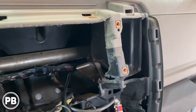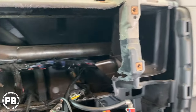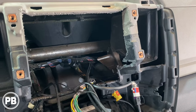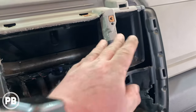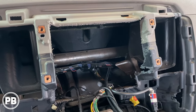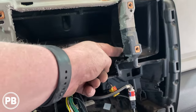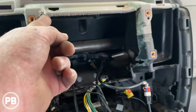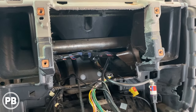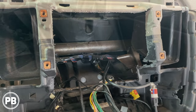This is how the previous installer went ahead and cut the dash. You don't need to cut that much — only cut what you need, but you have to leave these mounting points because that's the only location where your radio is going to mount. It looks like they probably used some sort of saw. Generally we use a multi-tool to help cut that — it makes light work, especially when it's just all plastic.